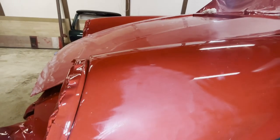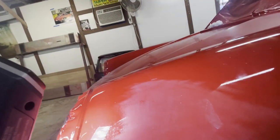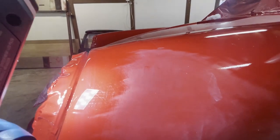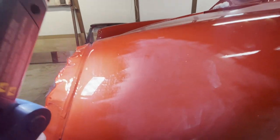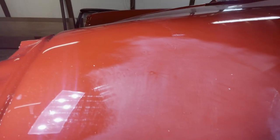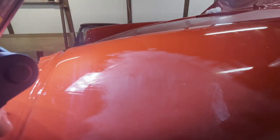So I'm going to show here, this area right here was sanded with some 1500 grit. And by the way, we're going to sand the whole car. That's part of the cut and buff process, as you'll see. But you might ask, well, why not just sand it? That should take out the nibs. Well, it doesn't. If you see here, there's still a nib right there. And sanding did not remove that,